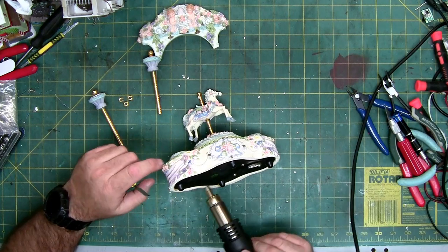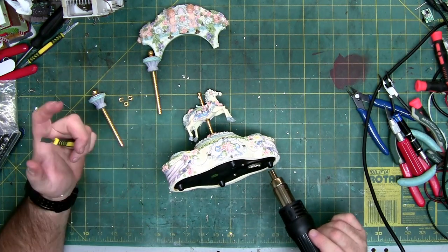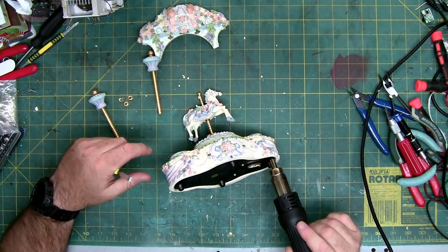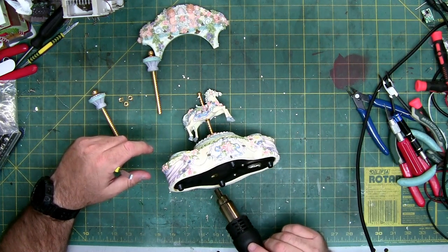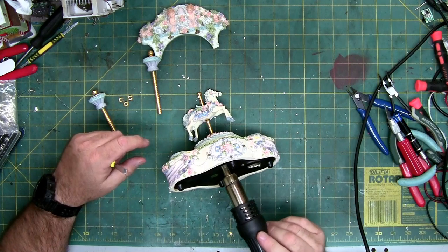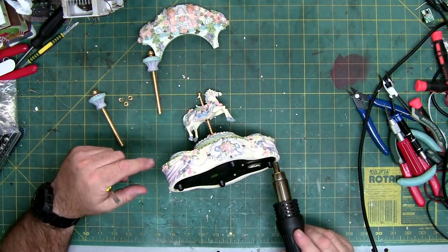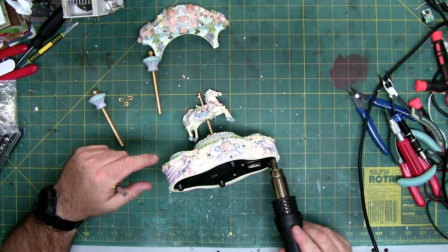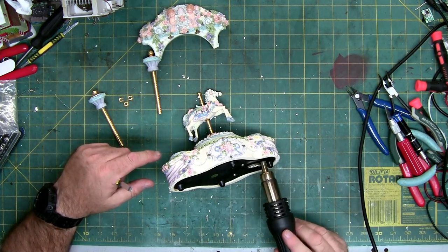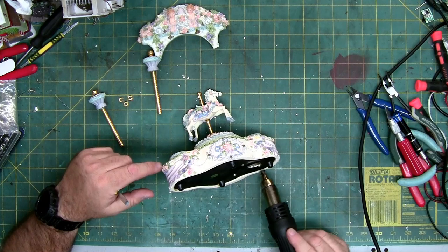What's nice about this is if you break this wood, let's say, it's a piece of balsa wood, it's very thin. You can get it from any craft store, draw the shape, cut it out, and put it back in. So if you end up breaking it, it can be replaced. And all you need is some black spray paint to make it black again. Heck, you can even go into a hobby store and go into the expensive section where they have the wood for the Cricut and the Cameo machines and buy that. And you can put it in your Cricut or Cameo and have it cut out the shape. That's too much work. I'd rather just trace the broken piece onto another piece of balsa wood and just use a pair of sharp scissors or a coping saw. Or if you have a sander, you could sand it down too, like a drum or a barrel sander. Belt sander.